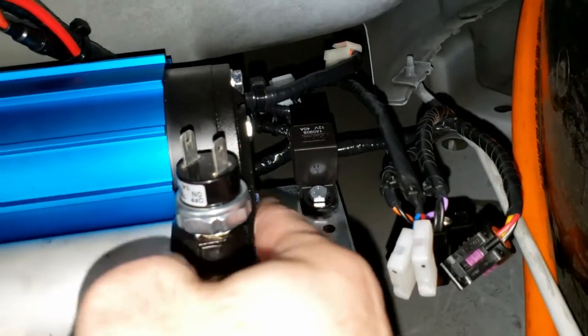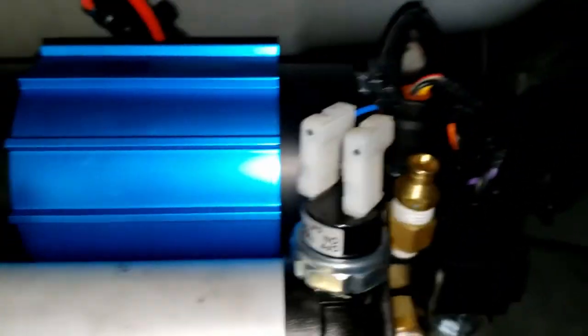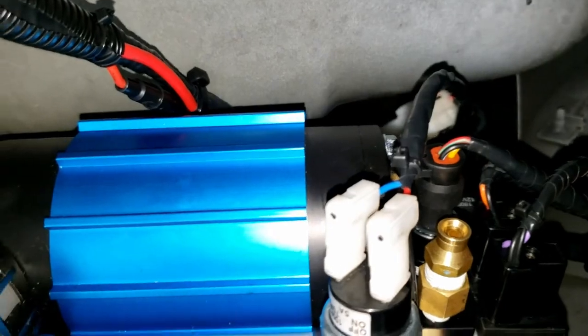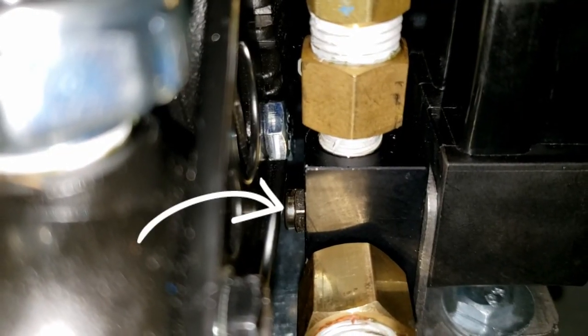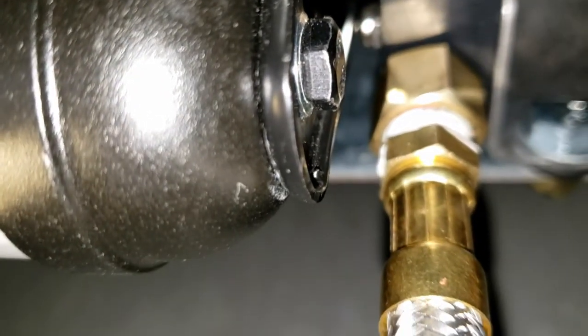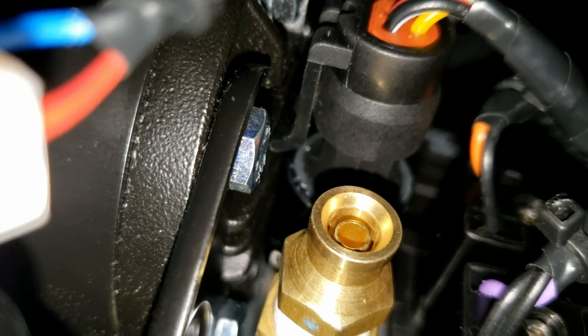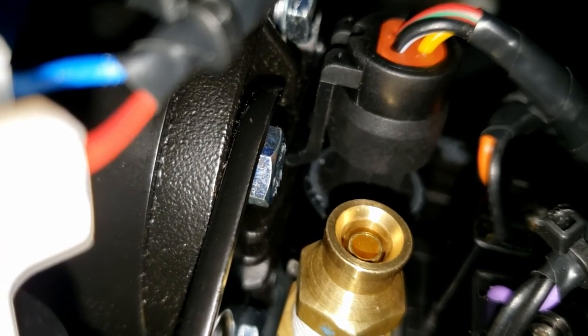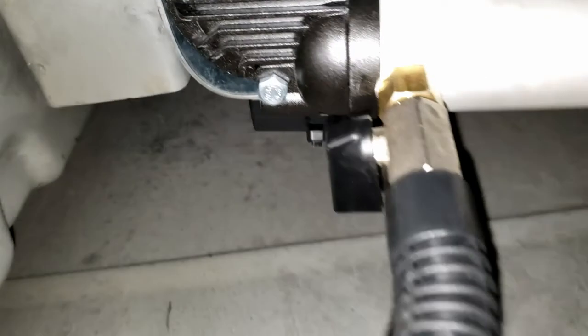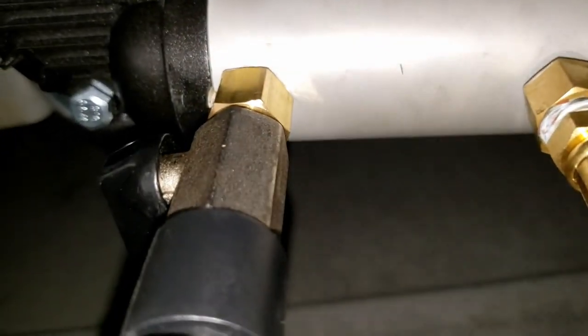I have everything hooked up and installed — it's quite a nice moment. There is the deflate solenoid, which just clears the compressor bracket, exactly as I designed it when testing on the bench. We've got the brass fitting here that will lead to the airbags, and the orange airline that will go to the back. Everything should be connected and live now — all that remains is to straighten out the orange line and test everything.